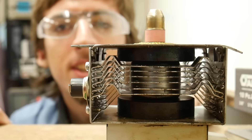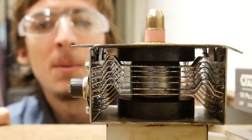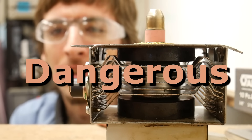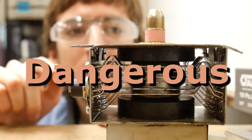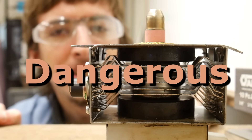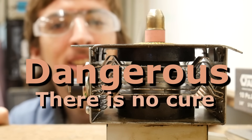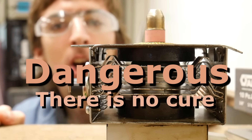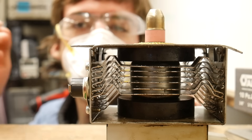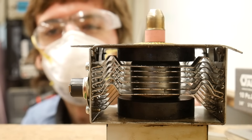This is very important. You see this pink band here? This is a ceramic insulator that is oftentimes made out of beryllium oxide, which is extremely dangerous. If it's broken and you get particulates either in your mouth or in your lungs, you could potentially develop a condition called berylliosis, which will have both acute and chronic side effects that'll probably end up killing you. And it's also carcinogenic. In fact, magnetrons are full of bad news, so I can't stress enough to wear some proper protection while you work.